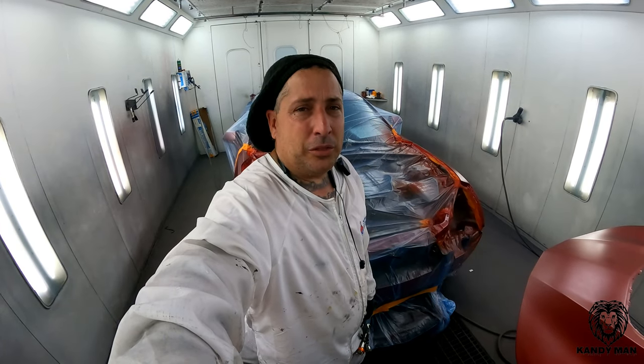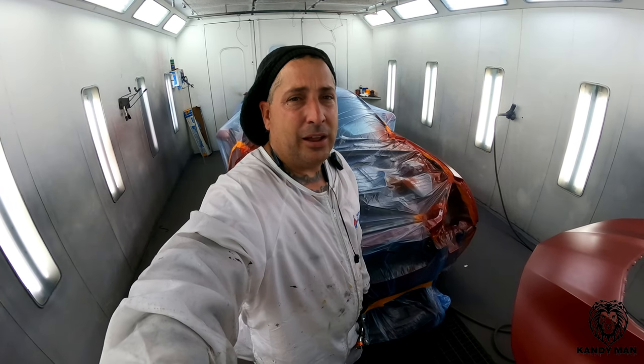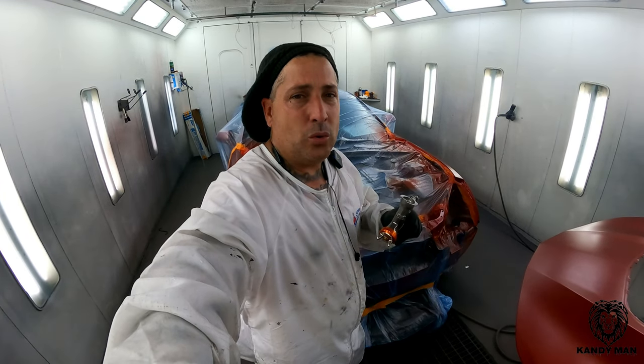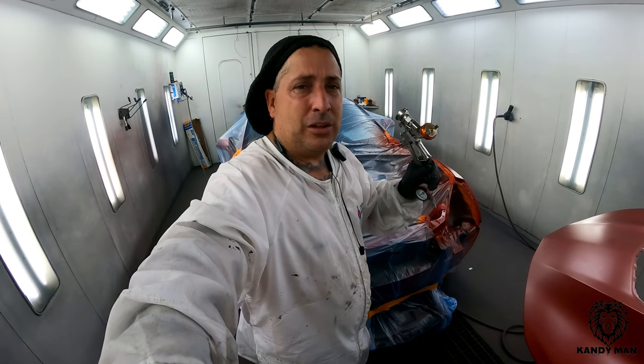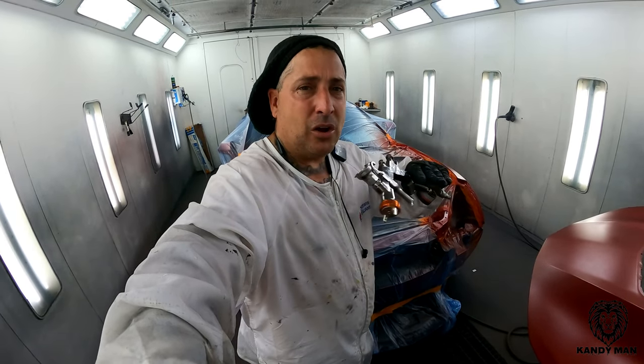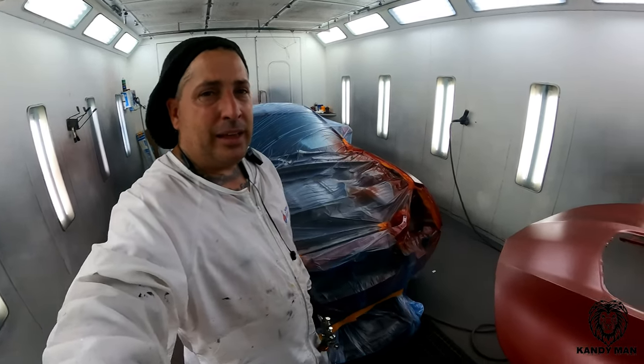And if you got a real thin clear, you're gonna lose half of it in the air and it's gonna be drying in the air and you're not gonna get a nice thick coat that's gonna lay out and put a nice amount of mils on. And also once it hits, it's gonna also flow out. So let's go ahead and clear it and get this thing shining.